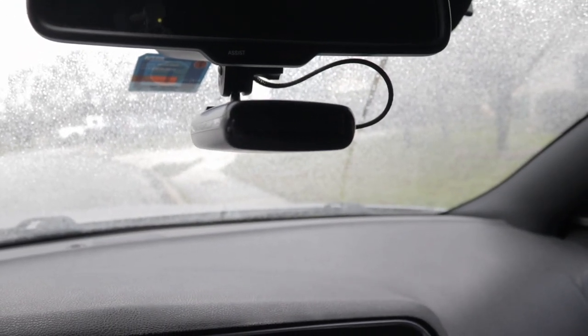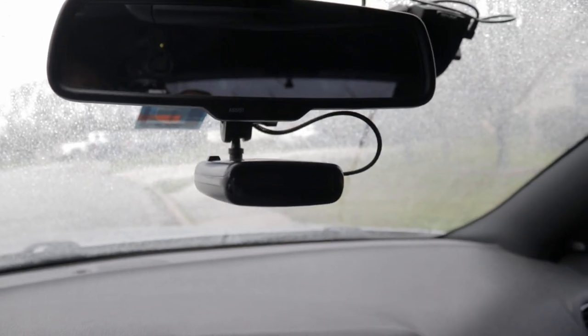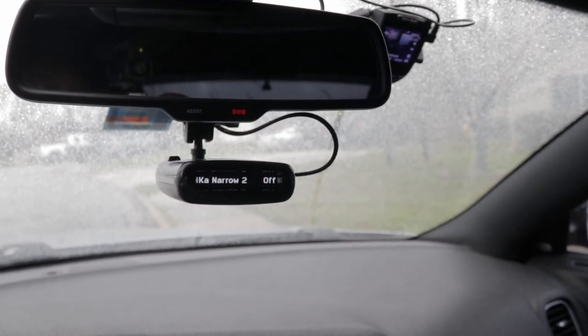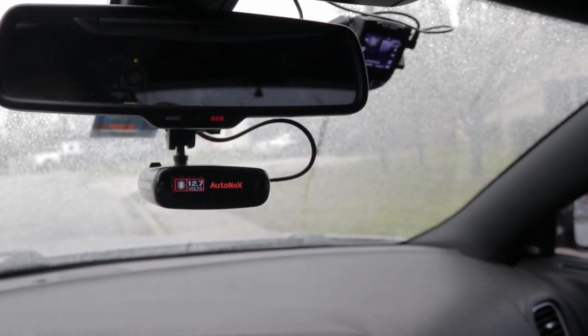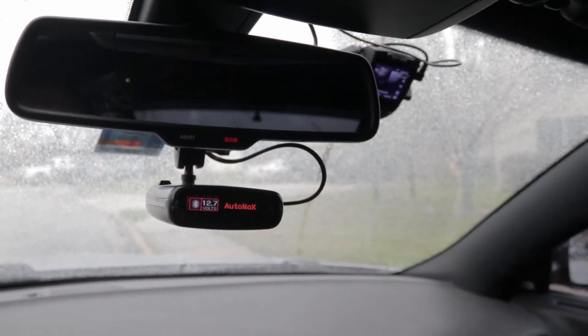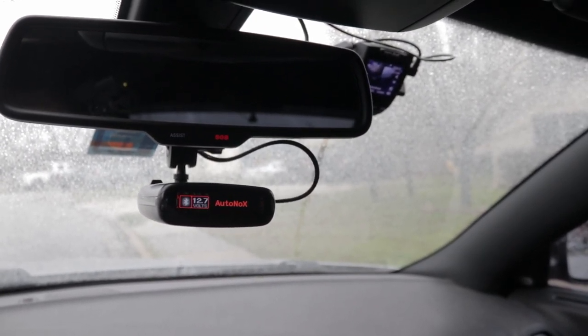Once you've tested that you have power, all you have to do is screw down the clamps for the mount, adjust the mount the way you want it, and then put back on the plastic housing and you're all set. When I start my car and put it in accessory mode, everything powers up — my camera is powered up as well. I don't have the camera hardwired to the car; I use a cigarette lighter adapter that only powers up when the car does, but I'm more than likely going to change that to a hardwire to the battery in the back.